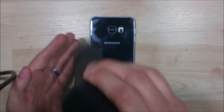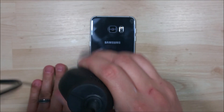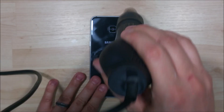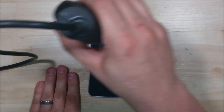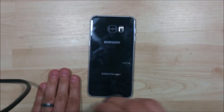We're going to start across the back here at the bottom. The adhesive should be along all of the edges of the phone. On past S6 phones it was down here in kind of a thicker portion at the bottom, so we're going to guess it'll follow that same pattern and heat up the bottom a little bit more. We'll be starting our entry in through the bottom, normally on one of the sides.